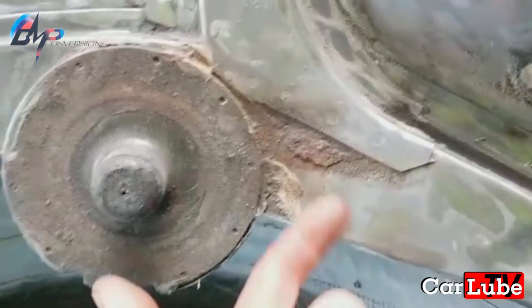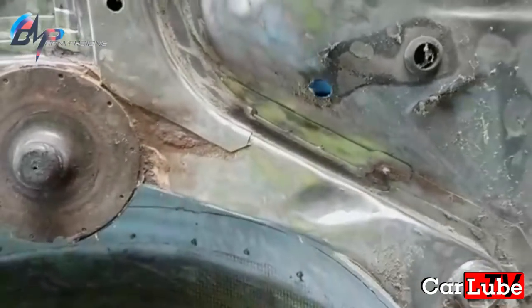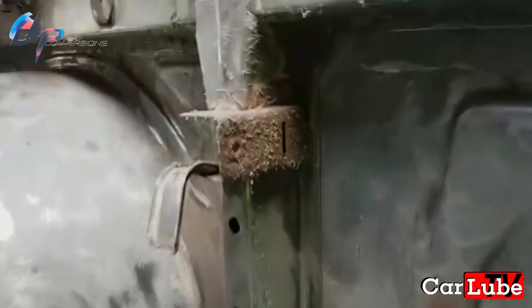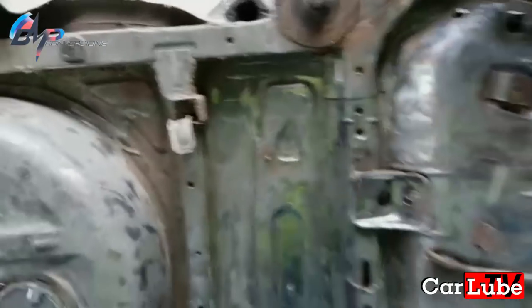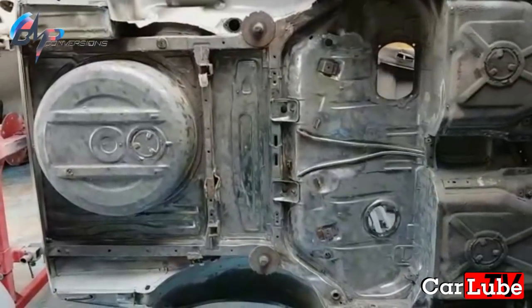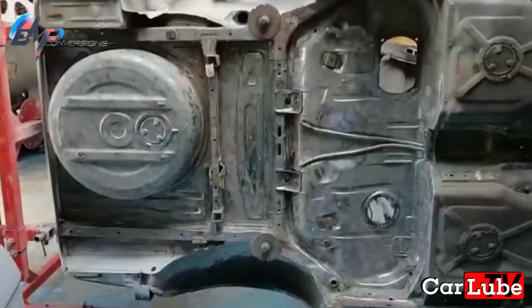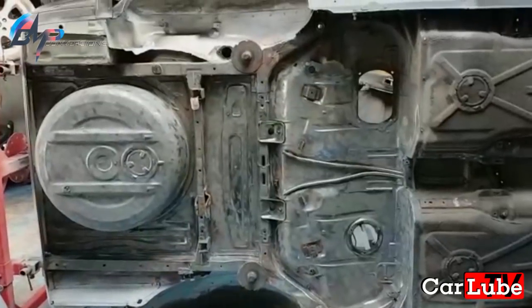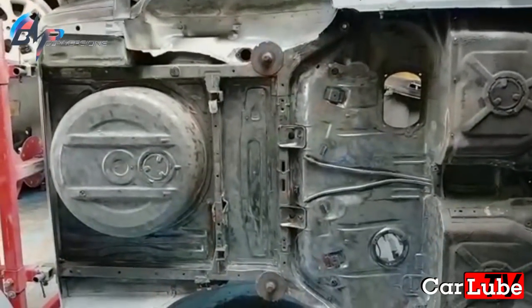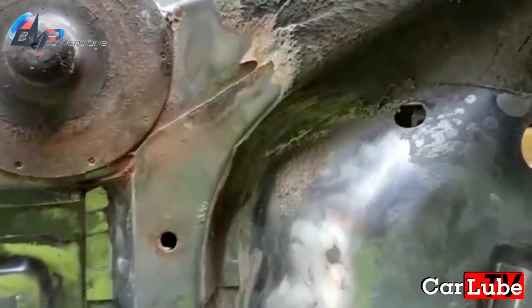You can see that's just a massive scab of rust. Hopefully it's just surface rust — if it isn't, we can repair it, no problem at all. The main point of this video is to show that we're doing everything possible to sustain the longevity of this build. I don't want customers coming back with an MOT failure in a year's time because there's a hole somewhere. This is the reason why I go to the extent of removing the under sealer off the whole underside, sandblasting, rust killing, repriming, repainting, then under seal, then paint again on top of the under seal. If for any reason this under seal moves in the future — cracks, gets caught by a spring, and water penetrates — when the water penetrates, it will just hit a surface of paint. So it will go through the under sealer, hit paint, and won't rust anymore.